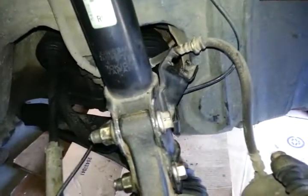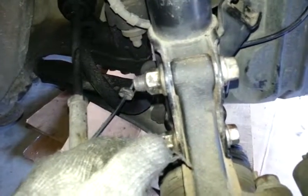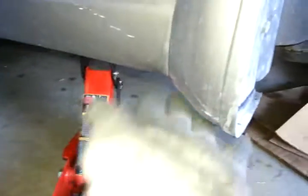To install it — this is where I had the problem. I couldn't get this bolt to line up so I could put the bolt in; it's very difficult. I found it easier if I lift the car up high enough. When I lift from here, I'm able to use this pry bar here as a lever and pull down like that — what I'm trying to do is push the control arm down so this falls down so you can get the bolt in.